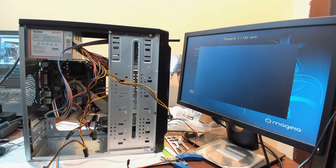And even when stuff like 486 boots, it's usually that a lot of features are missing straight up. You can't run stuff that needs FPU in a non-FPU variant, and then stuff that needs things like CPUID, SSE, CX8 is a big concern. And of course PAE is also missing. It's missing on this one as well. So it's sort of entering the retro mode where the operating system support is dying.